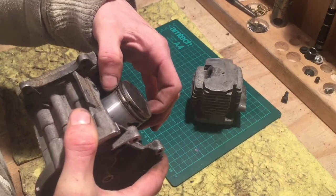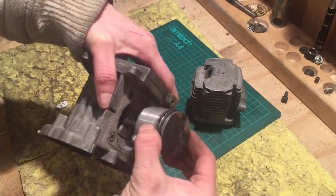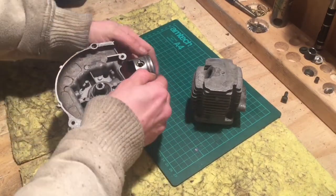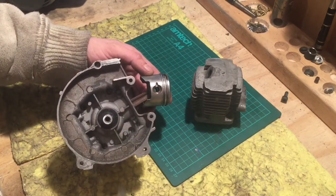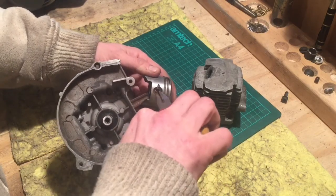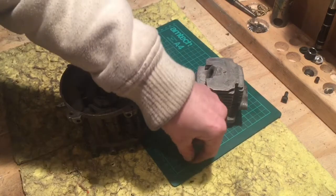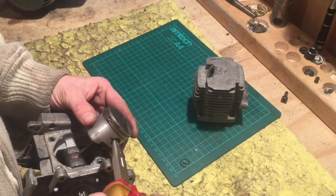These are fine but you're going to want to take yours out. Get a hold of the piston and just pull — that way it just extends the con rod to its furthest point. Now inside the side of your piston you've got a little spring that curls around. You want to just tug it so it shrinks and pull it out. There we go — that's the clip out. You don't want to lose that, it needs to go back in. From here I usually just pop the bar in the middle through.